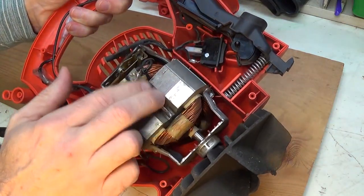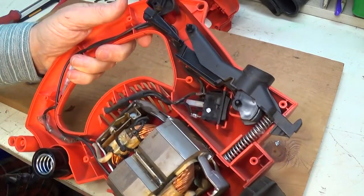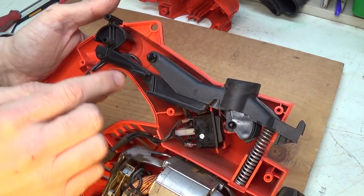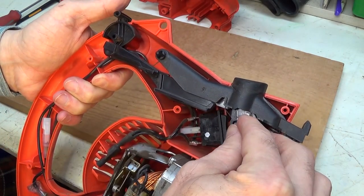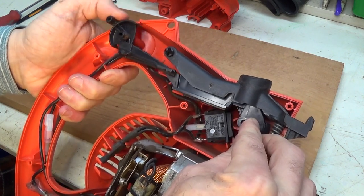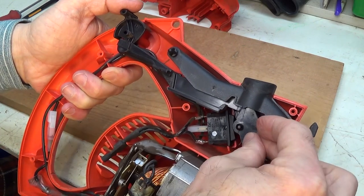Right here, this is the motor itself — the fan motor. And again, if this is blown, then essentially we throw this away because this is kind of an expensive part; you might as well just buy a new blower. But again, I think it's the switch. Now, if you look at the exterior end, this is kind of the exterior switch here, but it's not the actual switch itself. This basically controls this lever arm. So that's off, and then there are two power settings — a high and a low. But that basically controls this arm, and then it controls this little switch activator bobbin here.